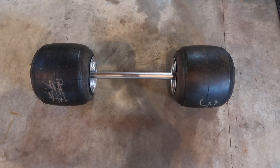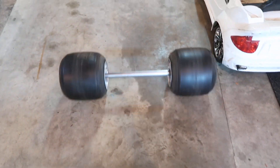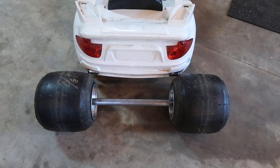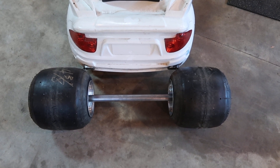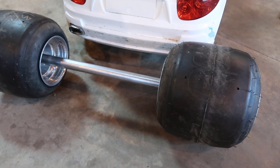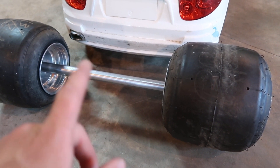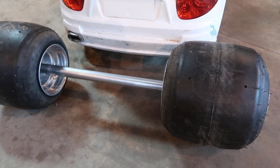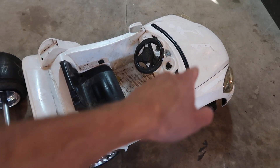I bolted both sides on and snugged everything up by hand. There she is — much like I said when I did the measurements, to tuck half of each tire inside the body it was going to be a 24 and 3/4 inch long axle. I still need to build the plates that are going to serve as the tensioner for the chain. I still need to figure out how I'm going to attach the sprocket and the rear brakes — shouldn't be that big of an issue. I still need to figure out how we're building the rest of the tube chassis and locating the engine in the front above the steering.